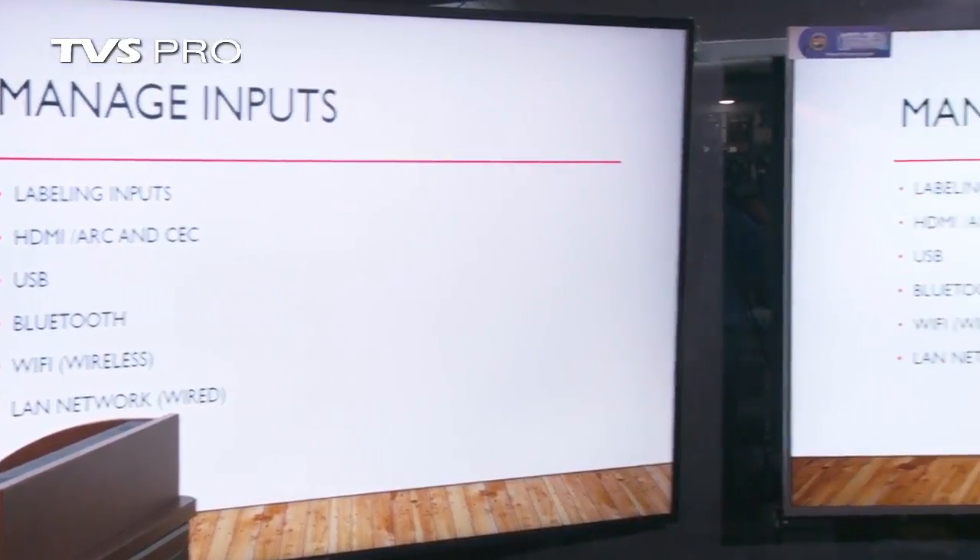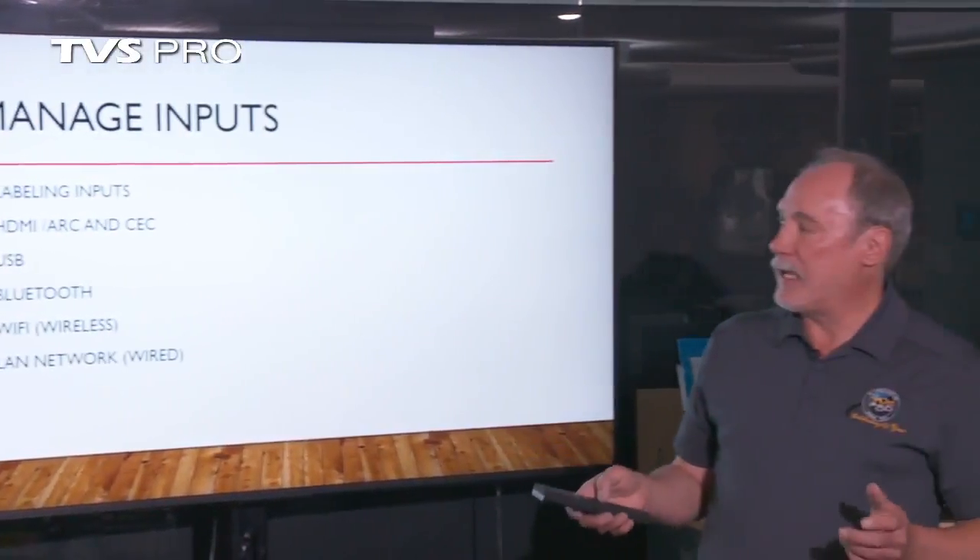If you are using an external receiver for audio, when you plug that in, you may want to make sure you're using the HDMI port that says ARC. ARC stands for Audio Return Channel. What that means is when you hook your receiver up and start streaming like a Netflix video, the audio from the Netflix movie will go backwards through the HDMI cable and feed the audio receiver, outputting through those speakers in 7.1 or whatever surround system you've set up. You don't have to run an additional optical or coaxial digital connection — it'll all be handled through the HDMI port natively, and it'll go both directions.